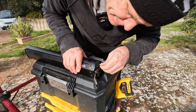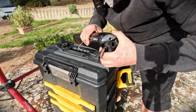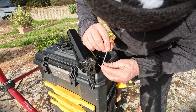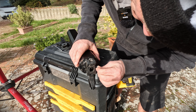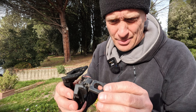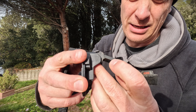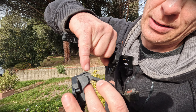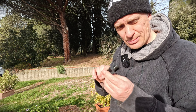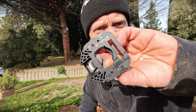You need to remove these bolts from the end of the battery. You don't need to fiddle with anything too much — that should slide off. There's the cover off. These are mounted in the lower hole so they're not done super tight. This is probably the smallest fault I've ever seen on a bike part. If you look at the side profile, you can see in that channel that it's snapped off there — it's just gone, so it doesn't retain it anymore.